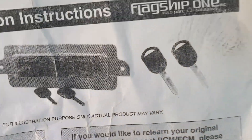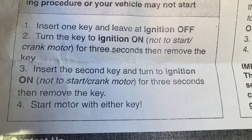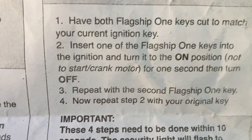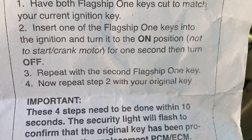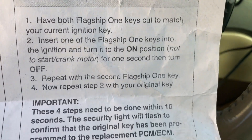This place is very good on the computers. They give you a new PCM — you tell them your VIN number, your year, model, and make of vehicle. It comes with two keys. You just have to go to your locksmith and have them carve the key into it from your original key, because they come programmed but not pre-cut. So you just get them cut at your locksmith to fit your vehicle key. It fired right up. Here are some instructions they give you — there you go, those are the instructions.